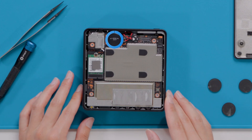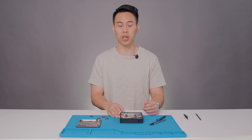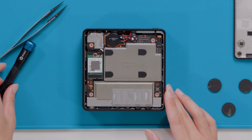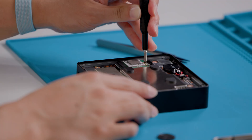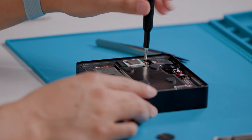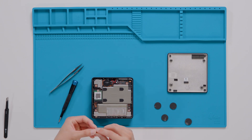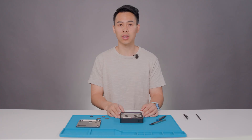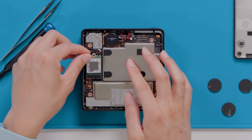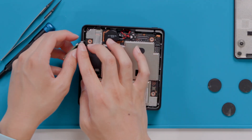At this point, the battery itself is exposed, so make sure that at any point from here on out, you're not touching or pressing on the battery in any way. Now to continue disassembling and removing your motherboard, we're going to use a PH1 Phillips-head screwdriver again to unscrew and remove the one screw holding down the Wi-Fi card. We also recommend that you count screws and place them away from your device as you go along to ensure there will be no loose screws remaining inside your device when it comes time to reassemble it. With your hands, carefully wiggle the Wi-Fi card to separate it from the connector on the motherboard and route the Wi-Fi card away from your device.